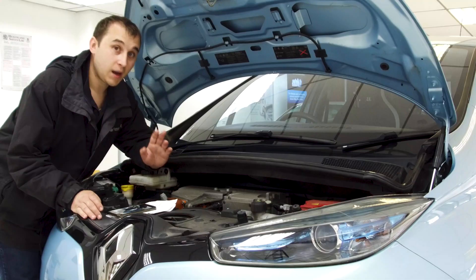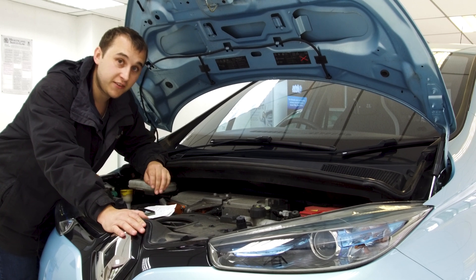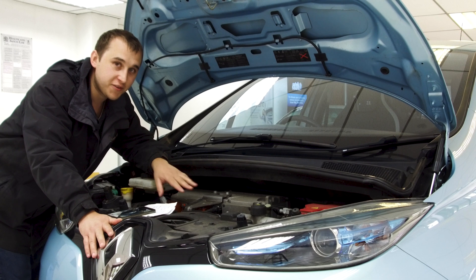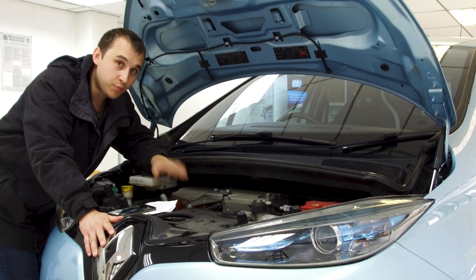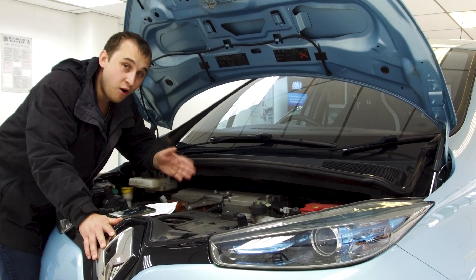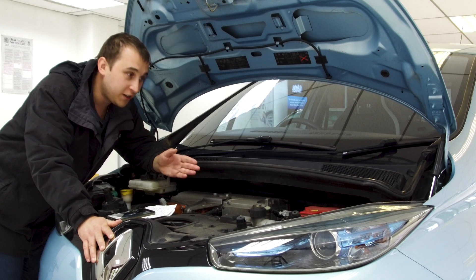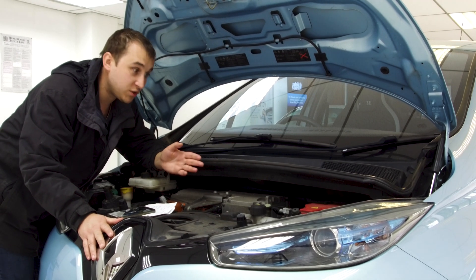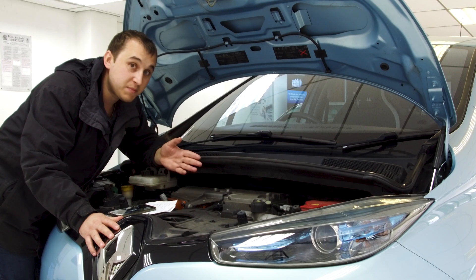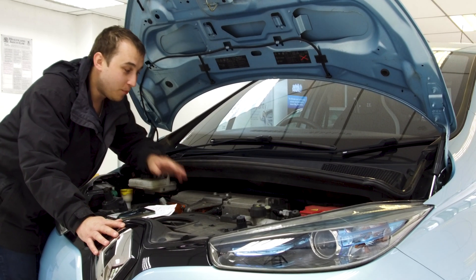However, it's been a year, so it's time to do some maintenance on the Renault Zoe. This is a 2015 plate and it's still on its original Renault battery — I ignored Renault's recommendation to change it at three years, and it's now over five years old and hasn't failed. During lockdown it wasn't used for two or three weeks at a time, which triggered the check electrical fault warning, but keeping the door opening and taking it for occasional runs sorted it out.